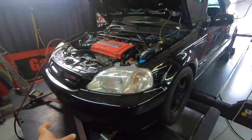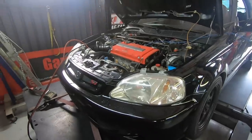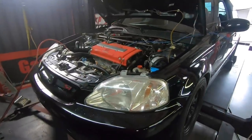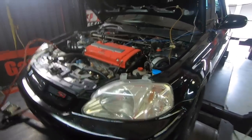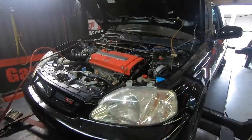It's an all motor B20V, 13.5:1 compression, built head, the whole nine yards. It is on stock rods, so we have the rods machined to the pistons and got it all set up correctly with help from our local machine shop.